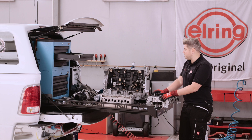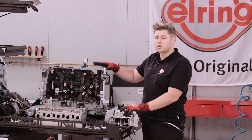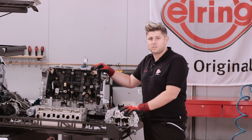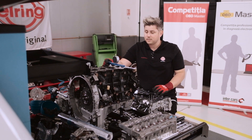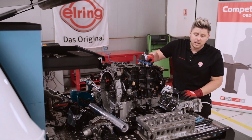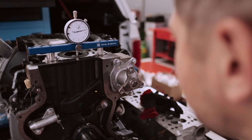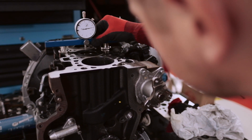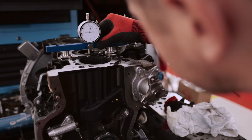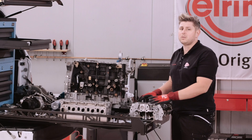The next step is we have to check the piston protrusion of our engine. The piston protrusion is very important to figure out so that we later use the right thickness of gasket. To check the right piston protrusion, you have to go to top dead center with your pistons. All four of them are important to check because we need to know the highest value. Check each piston once here and once there — not outside on the piston, but on the inside on one line. The biggest value was 49. Now we can check on our web page what is the right thickness of gasket and the right matching part number for it.